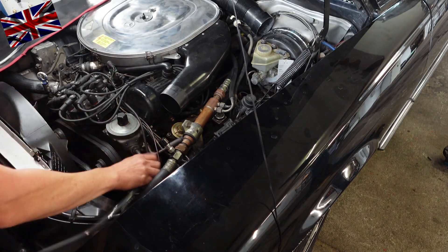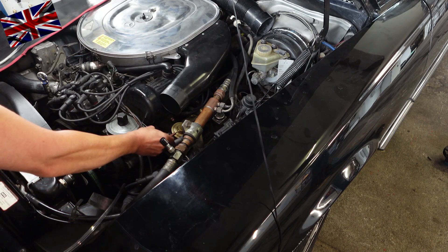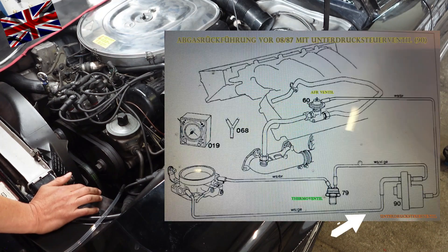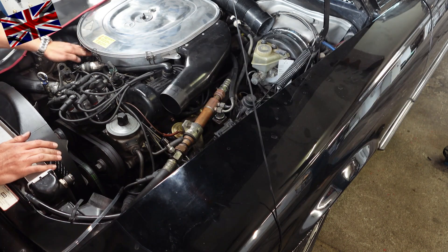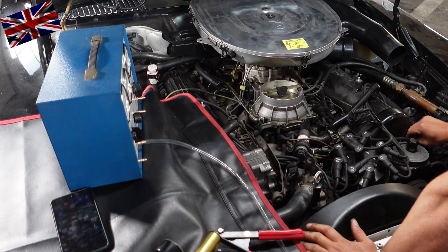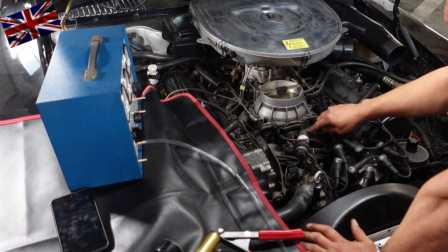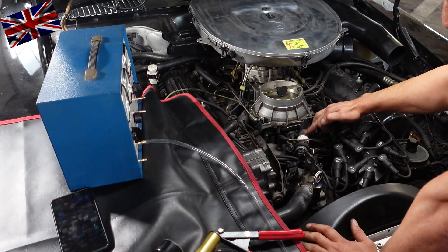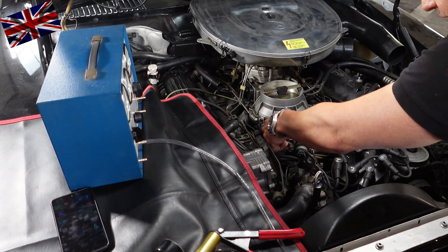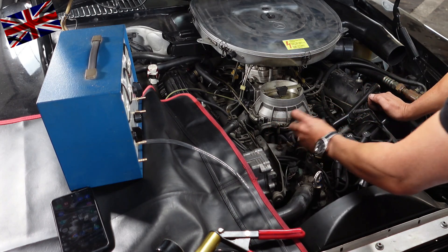Please see the drop-down on the right-hand side. Component number 9T has been deleted — it was an auxiliary vacuum control valve; they replaced it with an electronic unit. This thermostatic valve is sitting right here. This reddish-blackish vacuum line leads from the EGR to the thermostatic-controlled valve. For better visibility, the line has been placed above the idle control unit. From this point of view, the blackish line leads back to the EGR. We now disconnect the hose leading to the EGR and bridge it with the vacuum pump.